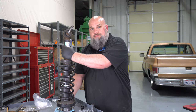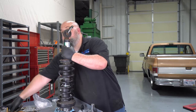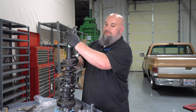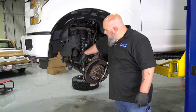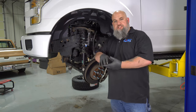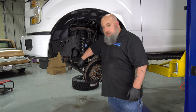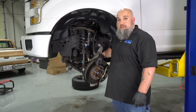Adding the inch and a half to two inches on the top takes away any room you have to get back onto those bolts. If you've done any lug nuts, you'll know this — it's the exact same concept. These are just knurled bolts being held into the bottom bar. Put them into place, tap them with a hammer a couple of times to get them to sit and get the knurled end seating down in the bar. After that, just put the nut on from the bottom and draw it up tight. It'll seat all the way back down into place — and that is how you get the strut in.